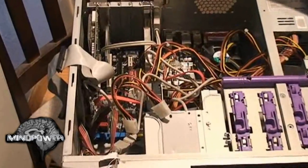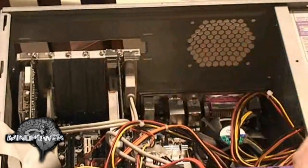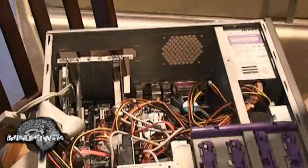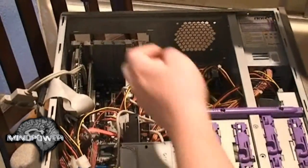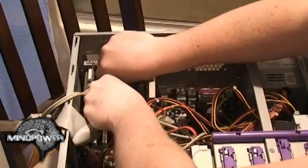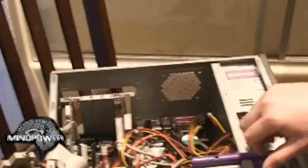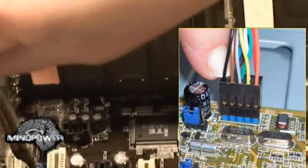In order to get in here I'm also going to have to remove my network card from the computer just to get inside there. Then we're going to zoom in real close and apply these pins where they need to go. So the first thing is to unscrew the part holding the network card. Very carefully take the card and lift it straight up and out of there.